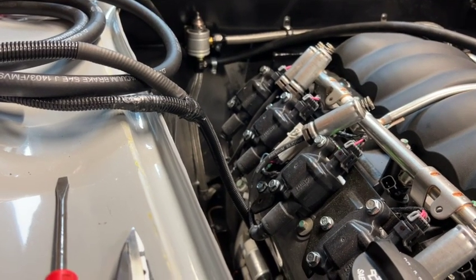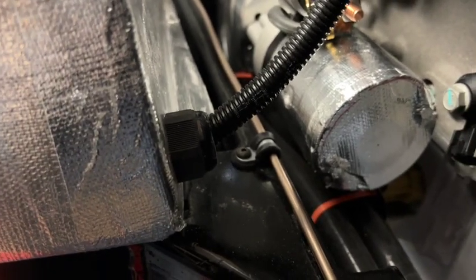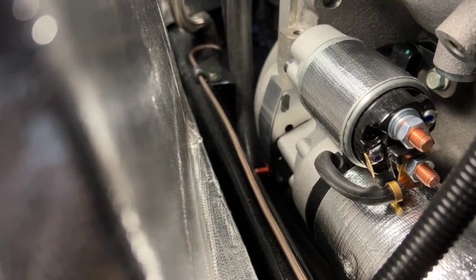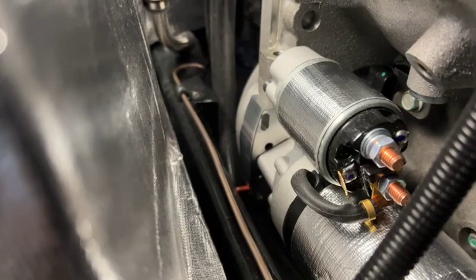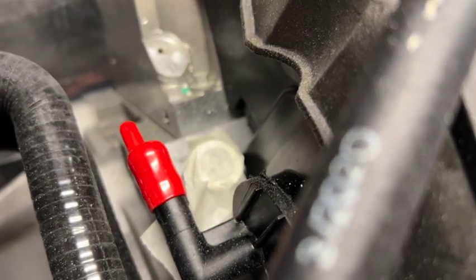Here's the engine leg of the loom. I've used an electrician's through-the-wall grommet type fitting to stop any chafing going through the fibreglass box — that's quite nice. I'm going to add a couple of P-clips to those existing P-clips so the wire has something to follow and is held neatly away from anything for the IVA inspector. A couple of wires need to wrap around the other side of the engine — notably the water temp sensor just down there, and the oil pressure sender unit, then the wires go around to the alternator.